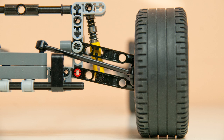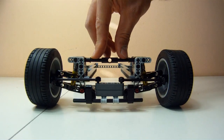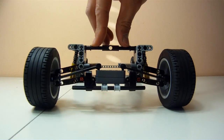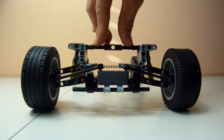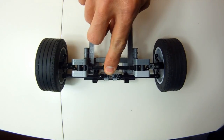While it is desired at the rear of the car, the opposite is true for the front suspension. Bump steer occurs if the steering link is not the same length as the suspension arm that it is closest to, or if the steering link is not parallel with that suspension arm, or if we have a situation when both of these conditions apply.